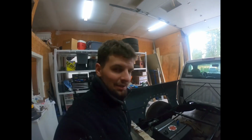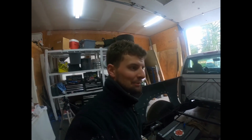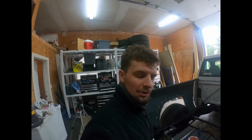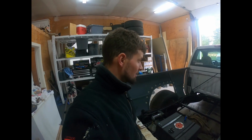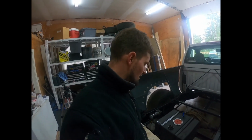So guys, this morning the truck wasn't too happy about starting up. Gonna go pick up a battery because I had to boost it again. So I'm gonna do that today. Probably going to go with a little bit bigger battery, just because I'm going to run a single battery, a little bit more cranking amps.